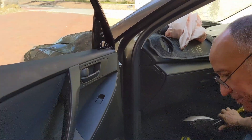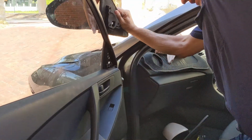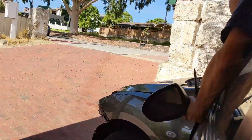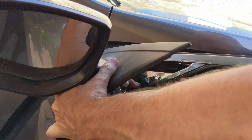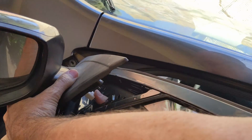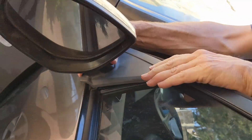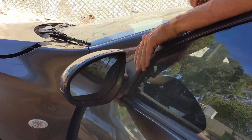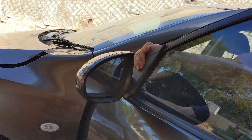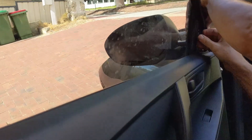So that's half the job already done. Now we grab our new one, come over here and put the electrical connector on. Just line up that electrical connector — it's a little bit tricky to get it lined up. There we go, we're on. Get the locating pins to line up. There we go, and now on the other side I'll just get started with these bolts.